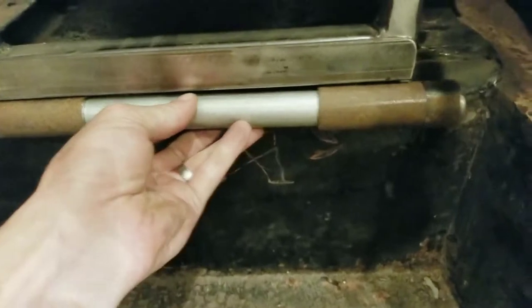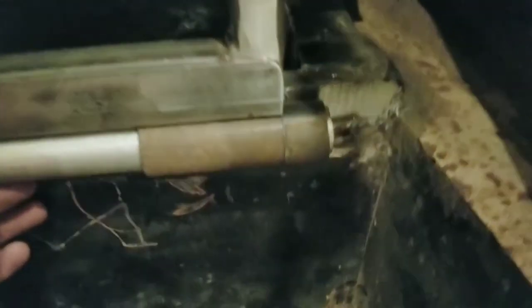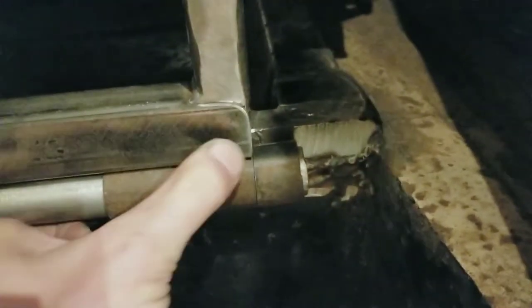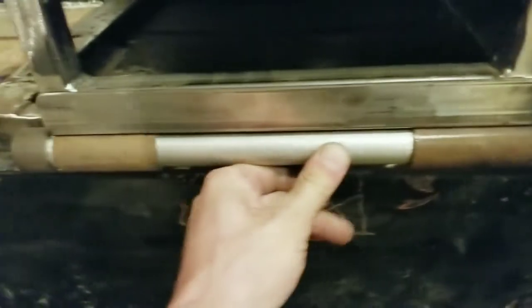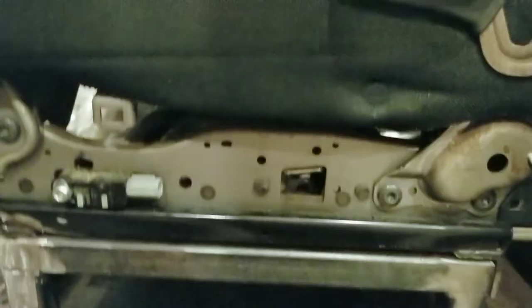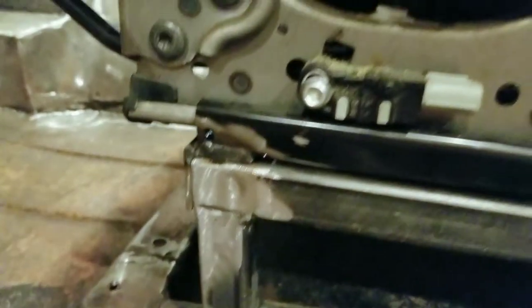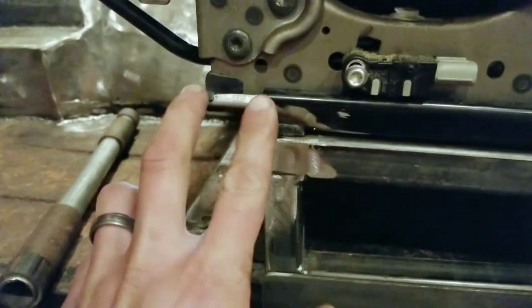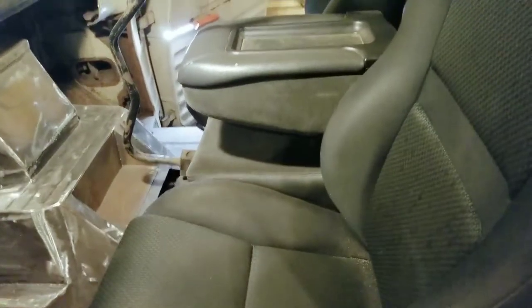My thought was to weld the hinge like this — the three-inch pieces will get welded to the seat track, and the one-inch piece will get welded to the truck frame. What it's going to allow me to do is pivot the seat up toward me on the driver's side once I slide the seat up and move the seat back forward to allow the seat to move. Before I weld in the seat tracks, I also want to make sure my seat sliding tracks are at the same position so the seats are in line with each other. Overall, I'm very satisfied with the seats — it's time to do some welding.